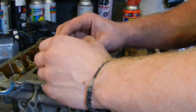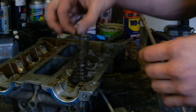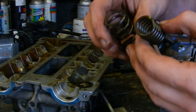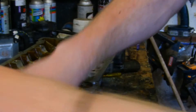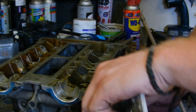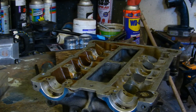It's just a simple step of moving the top hat. Give it a bit of a wipe so you don't get the place all oily. There's the outer spring and inner spring, and the bottom washer. The manual will show you how to put all that back together, although it's pretty straightforward, so don't worry too much about remembering anything tricky. After that, just tip the head up and the valve should just push out like that. And there you go — except for the valve guide, which I'll take to the shop to get out. Alright, thanks for watching.